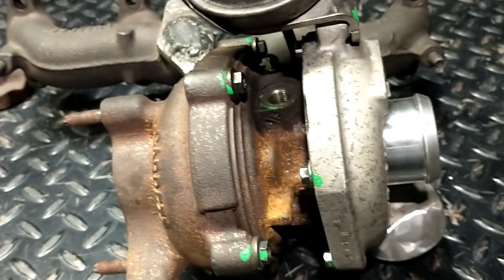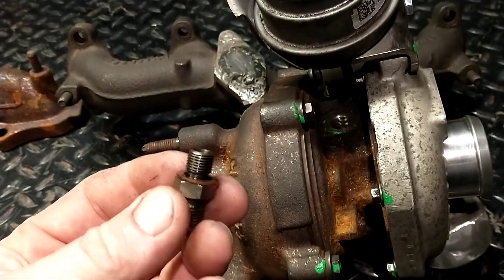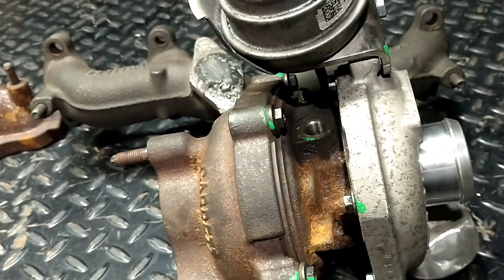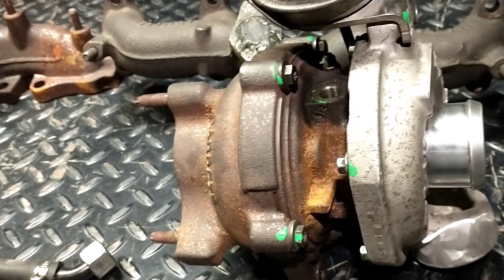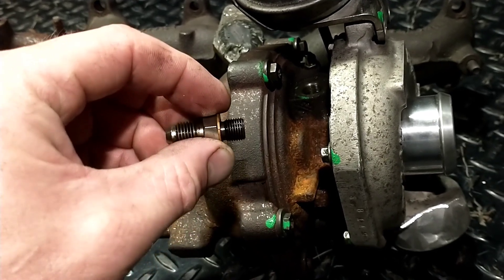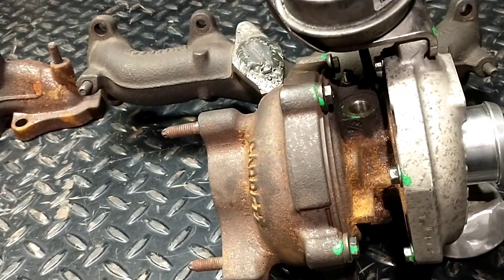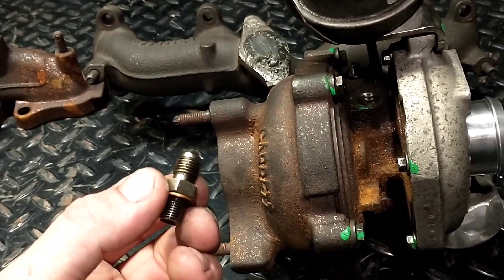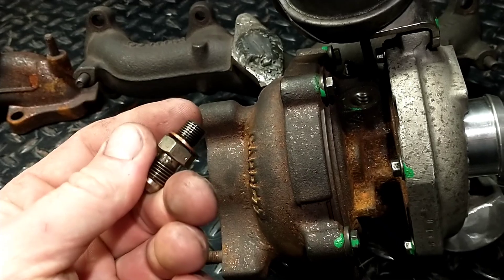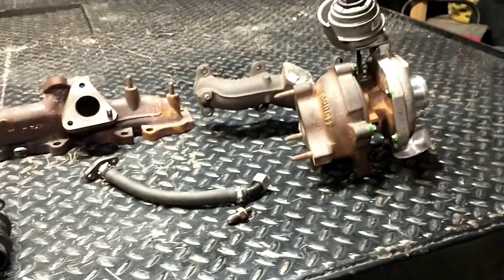Of course this turbo is one size bigger for whatever reason, so the M10 is completely loose in there. The size is M12 by 1.0. I actually found a helicoil-style reducer — I'll try to link it in the description — that you can screw over the top of this fitting and then it'll thread into the turbo. It's a pretty quick fix, and then I use AN fittings after that. As long as you've got that adapter, you can screw a universal oil feed right onto there.